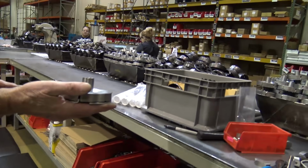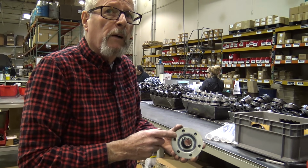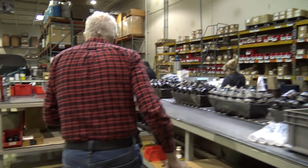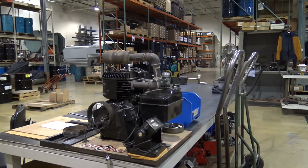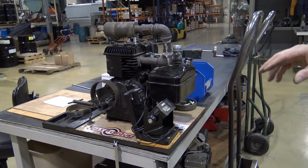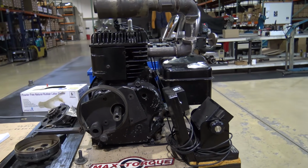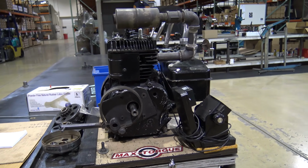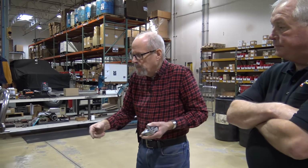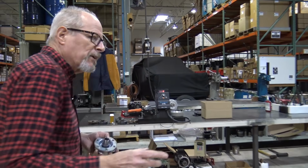All right, now I'm going to take this clutch, and a typical green spring would be coming in at 2,500 RPM. I've cut 3 loops out of this spring. Let's see where it's coming in at. Historically, we used to put them on a gasoline engine, have a band brake around it, and that's how we'd test the clutch and see it. We'd have 2 tachometers. One's a backup for the other one to make sure you're getting a good reading. But the gasoline engine, the fumes, the noise. So I redesigned that. Now we have an electric engine, electric motor, much more accurate.